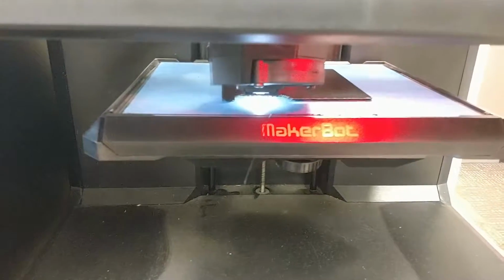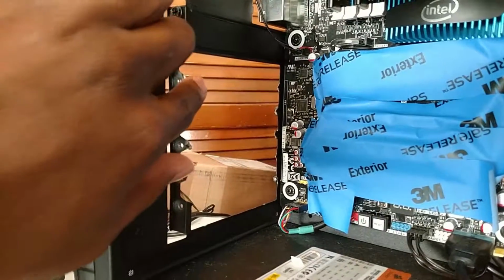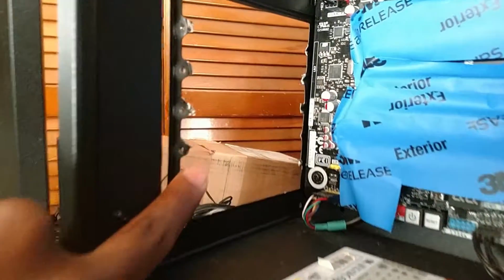Once that is completed, you need to prep whatever case you may have. I'll be using the Deepcool Matrix 55, but like I said, in theory this will work with any ATX case. Now if you have proper cutting equipment, this will turn out cleaner, but I managed with a pair of pliers. You don't need a Dremel or anything like that. Tin snips are what I'd recommend, but make sure to either mask off or simply remove any hardware that could get particles trapped in unwanted areas.